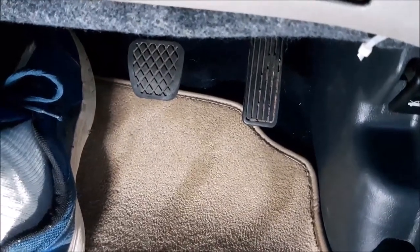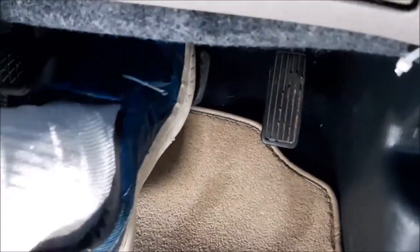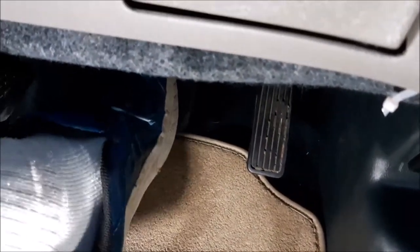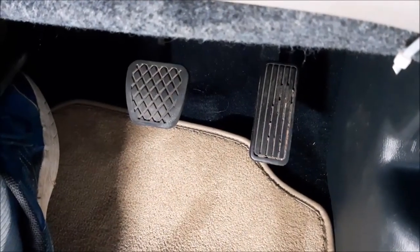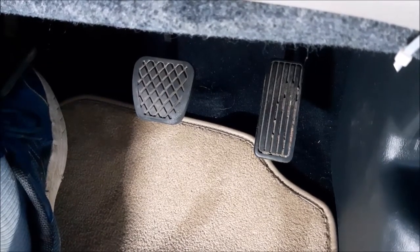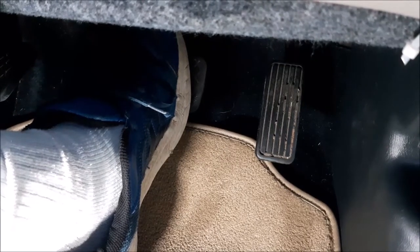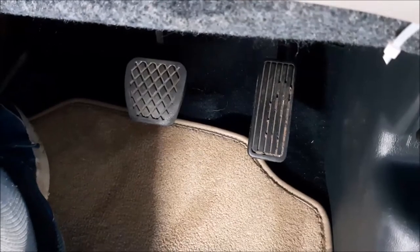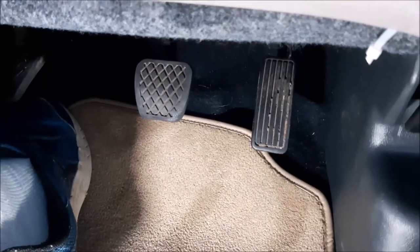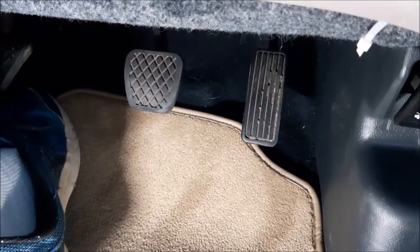Now we've done the driver's side as well. Hopefully all going well, the pedal should certainly not go to the floor — you can see there's just a small amount of movement. It will feel different because the engine's not running with the servo on. Then we just check that the brakes are locking the disc. Just a basic initial test to make sure that when you put your foot on the brakes, the disc does lock. Obviously the wheels are off and the car's not on the ground, but hopefully that gives a good initial indication.